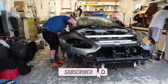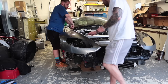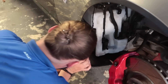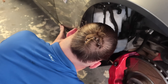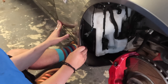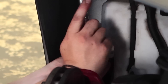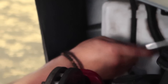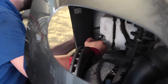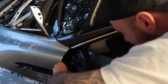With the wings fastened up we could start playing around with the gaps to make them as good as possible. We ended up packing out certain parts of the wings with washers already on the bolts when we removed them, which helped them fall into place much nicer. Once all that was done there was one final bolt in the top of the wing in the door shut which you had to work very carefully with a spanner, a small turn at a time.